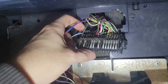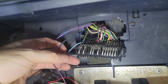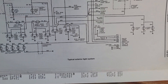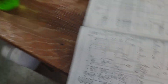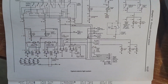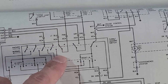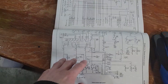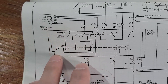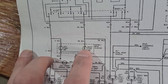This will be able to be taped up easier and better, and accessible for the future, which is really good. Before I tape it all up and test these wires, I'll go to the book and show you guys why I chose these two so you don't think I'm just pulling the coloring out of nowhere. As you can see, this is the typical exterior lighting system for a GMT 400. Your turn power comes in light blue, goes in here and switches. Then power from the flasher — light blue and dark blue go to the instrument cluster: left turn, right turn.